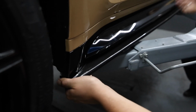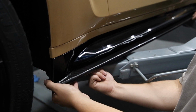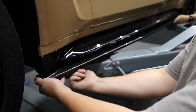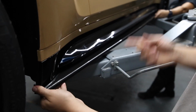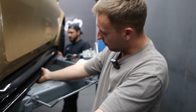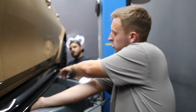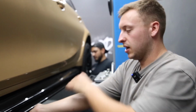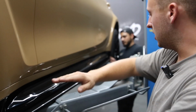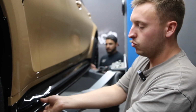So with two hands, I've got another hand on the other end. We go underneath, and what I like to do is put one fixing at the beginning here, then get to the other end and make sure it's still straight, because once you put a screw here, you lock in this position. Mario at the other end is confirming to me at all times, yeah, we're still good. I'll then put a fixing about a quarter of the way across, and then halfway through, and then I'll work on the back side. This way, if you pin it on the far left and the far right, you'll then get it bowing. We need to keep it all flat, and then you fix the last position at the end, and then it's perfect. So we're going to get underneath now.